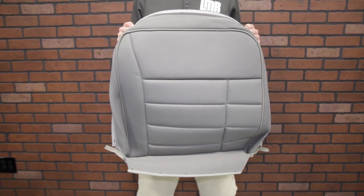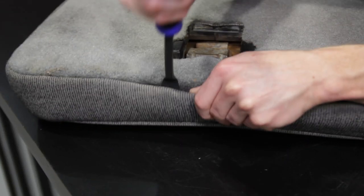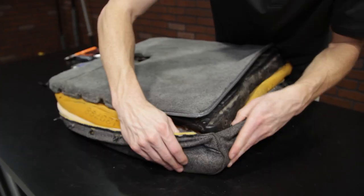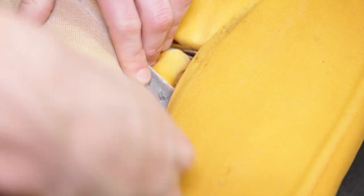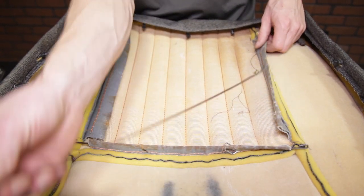Moving to the seat backs — these are side specific. The two bolsters that do not have horizontal stitching will install toward the inside of the seat. Remove the old upholstery by separating the clips with the pushpin removal tool. When you hook a clip, pop the panel tool quickly to remove the clip — moving the tool slowly can sometimes cause the clip to remain attached. Work your way around the entire seat and then roll the upholstery around the edge of the foam. Clip the six hog rings that secure the listing rods to the metal framing in the foam — two on each side and then two on the top. Remove the three listing rods from the old upholstery and transfer those to the new Corbeau upholstery.